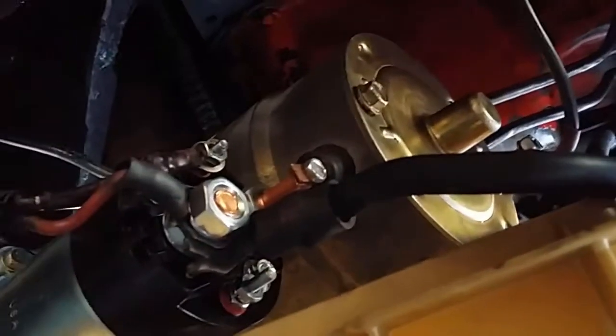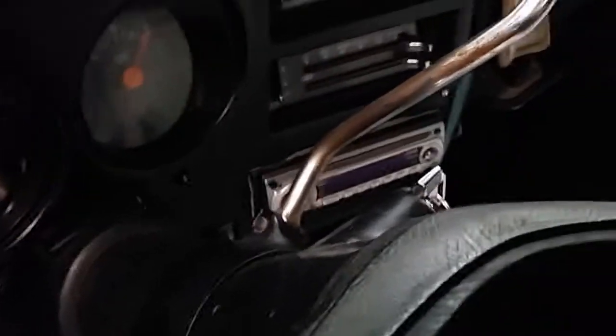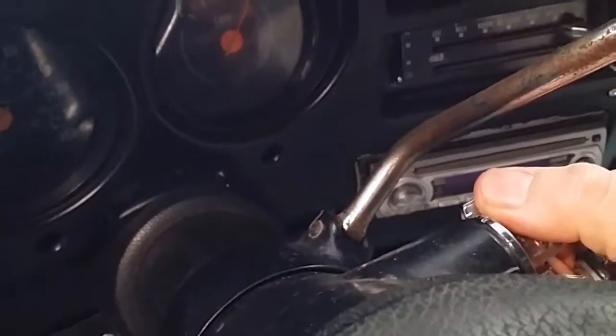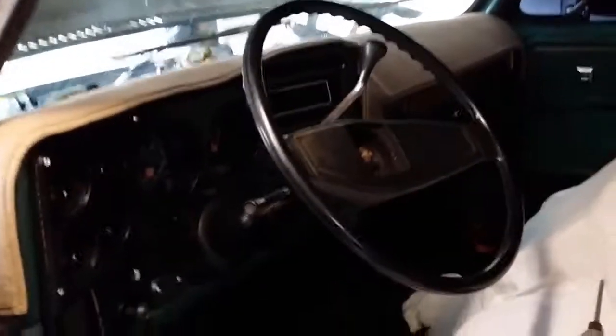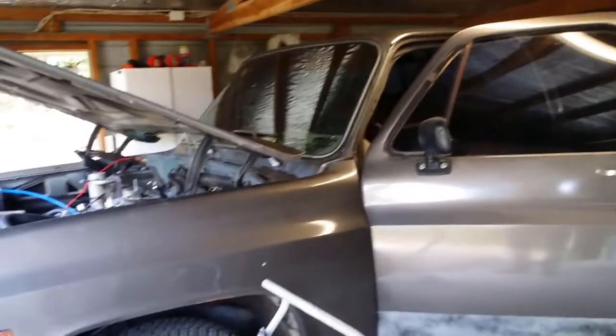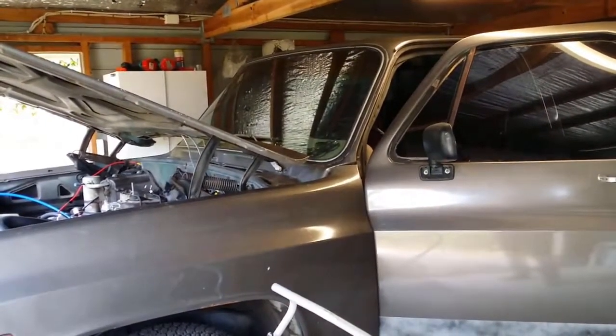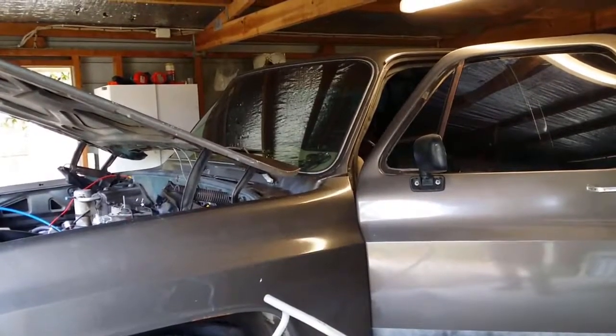Okay, so the electrical wiring is now attached. And we can hear that it works. Okay, unfortunately that's not the fix. Okay, so I'll crank it over. Okay, so it's looking more and more like it being the ignition key. The reason I haven't replaced the ignition key is when I tested the starter motor off the car, it seemed to work fine. But that's the next plan.